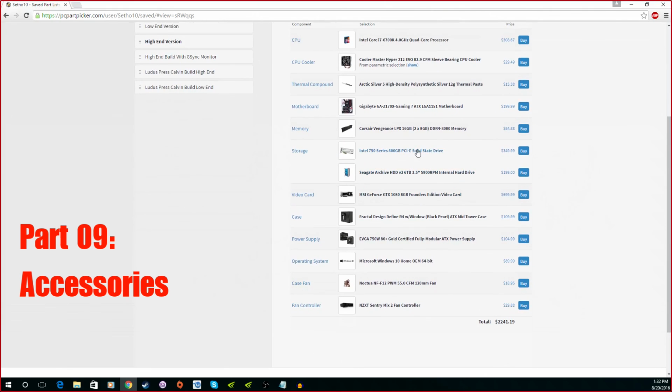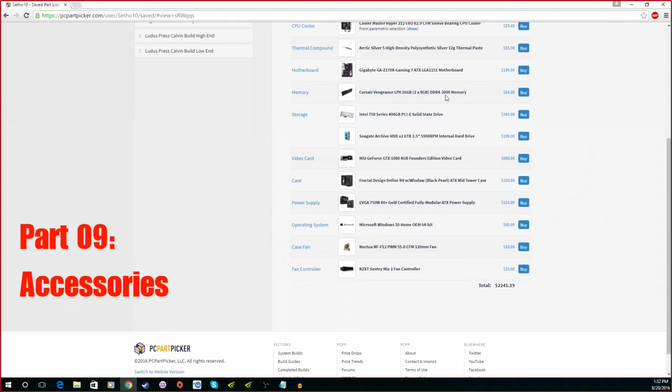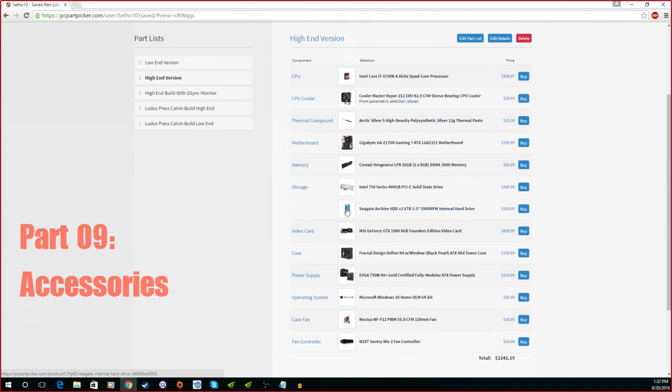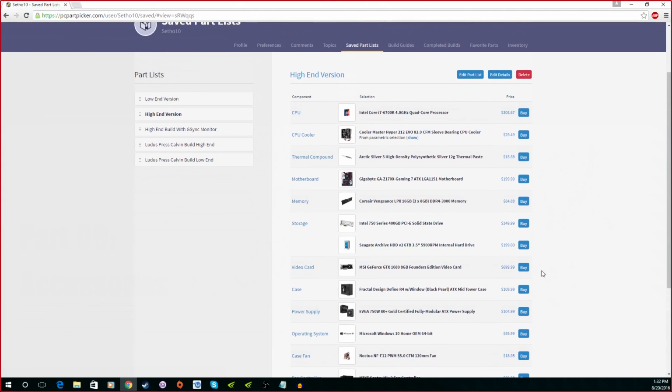And when I need that, I will move any game I'm currently playing, I would store on this hard drive here. Something that I want to keep for posterity's sake, for whatever reason, I would store on here. If I needed to access it, and it was a game or a super high definition movie, I'd move it here. So you have to do a bit of moving between the two drives when you have multiple hard drives like this, but the advantage is that you drastically reduce load times and stuttering. And we'll talk in detail about that stuff later.